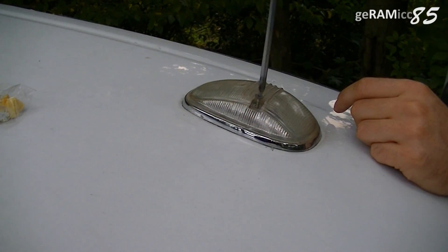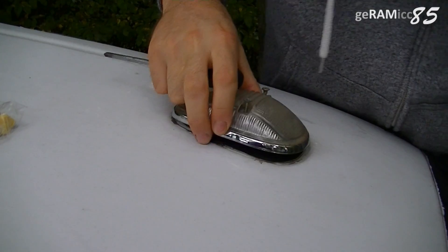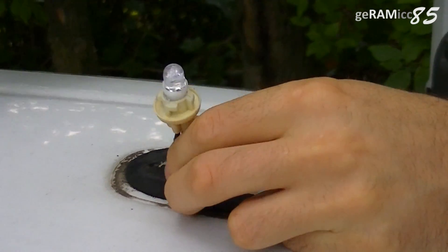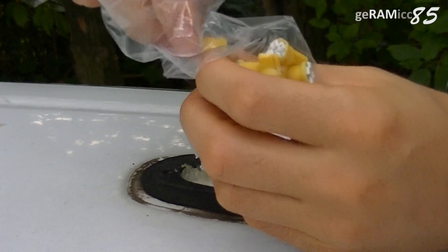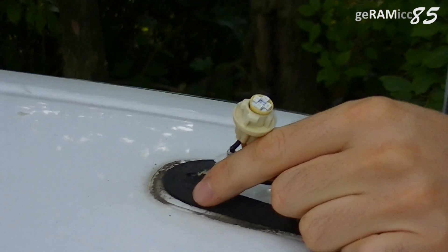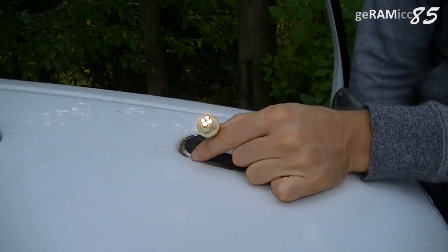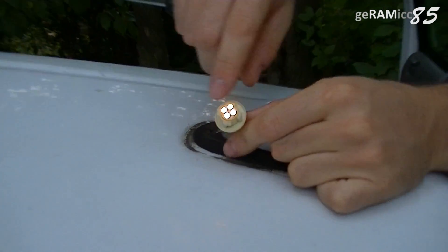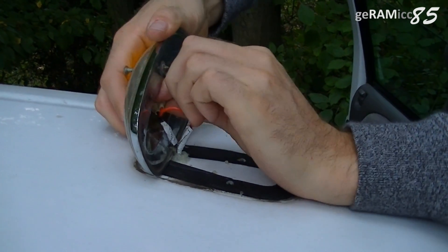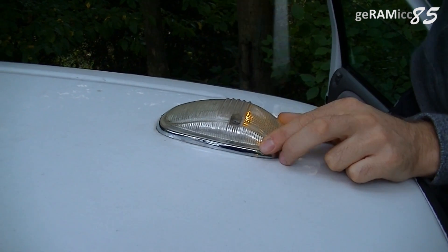I am using a normal Phillips screwdriver to take out the two screws holding the cab light. I take off the lens and pull out the rubber bulb holder from the bottom. Now I am replacing the old LED with one of the new 24-volt SMD LEDs. Before putting everything back together I make sure to test for the right polarity — otherwise I would have to turn the LED by 180 degrees. This one works fine, so I stick the LED into the lens, give it a little turn, and secure the cab light back onto the roof with the two screws.